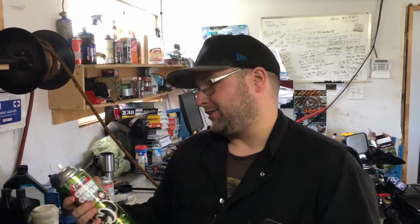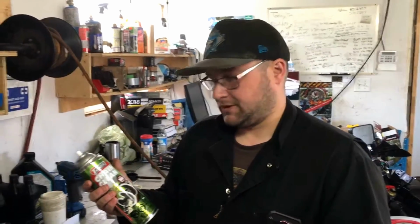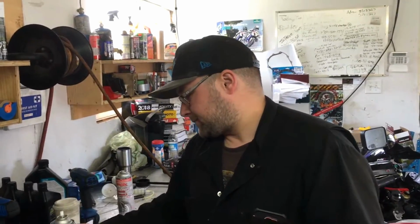But this is a great little kit, and people seem to use it quite a lot. I've seen that work before, and I've used it. It's excellent. It peels off the gunk and takes an old chain that looks like it's ready to be replaced and makes it look like brand new. I get shocked reviews from everybody that I do. It'll really bring the chain right back to what it looks like new. So you wipe off all the gunk, and then it's good to apply a good high quality chain lube or chain wax.